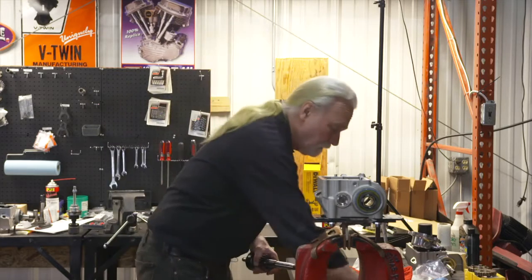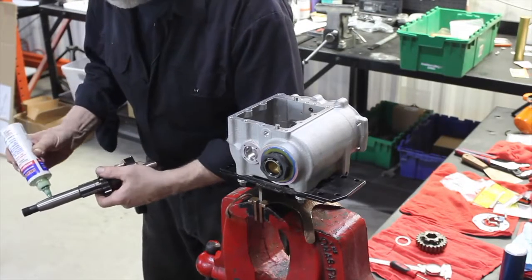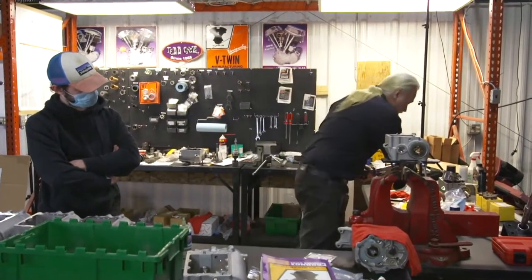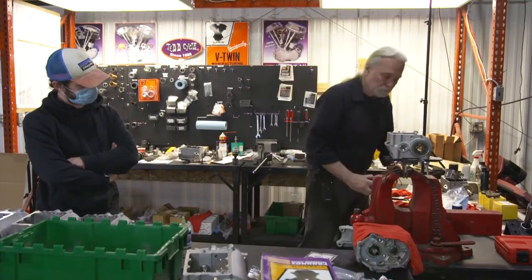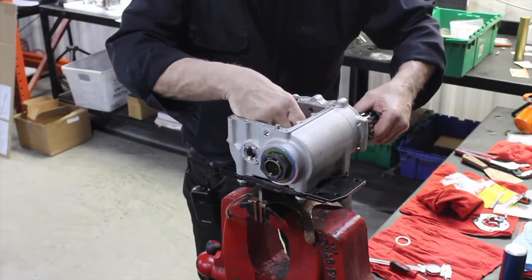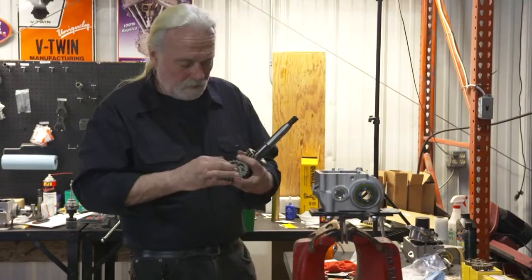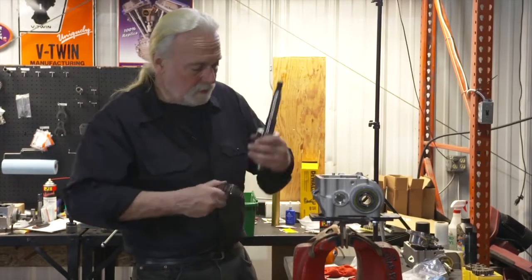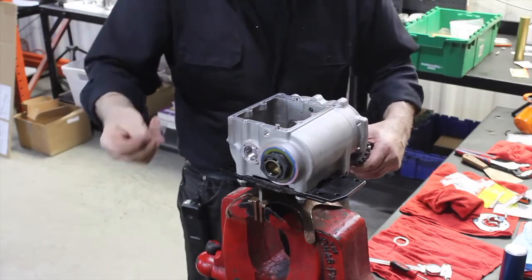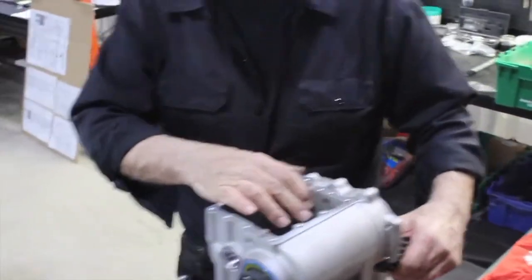We start with our main shaft assembly that's now completed, ready to go. A little bit of assembly lube where she's going to run through the bushing so it's not dry. This is a little tricky. Now we've got to come through everything at one time here. We set this in. So in other words, we start with our main shaft going through third gear, our thrust washer, and last our retaining ring for that assembly that's going to be affixed to the main shaft.